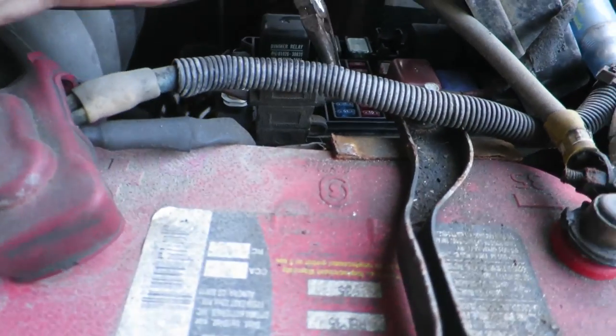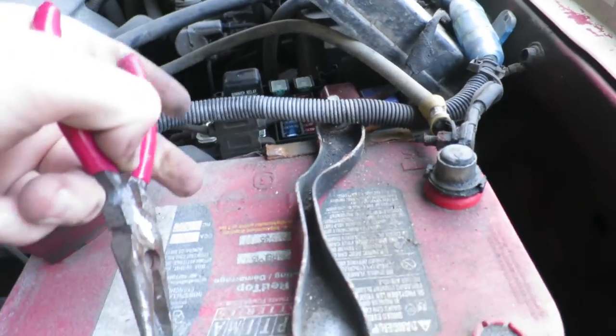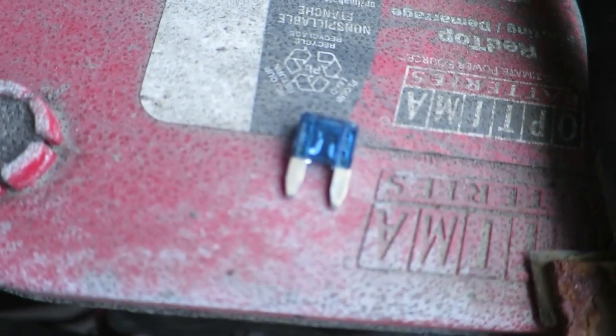It's all back together, but it's not turning on. I think it blew a fuse because, like, when I was screwing it in, I didn't disconnect the battery, whatever. But all the fuses in the fuse panel are good, so maybe like the previous owner put another fuse in somewhere for the radio, because the radio is probably connected to these. I have to troubleshoot that. I'll figure it out later. I'm starving. That fuse is blown. Gotta get another one. Okay, now let's go eat.